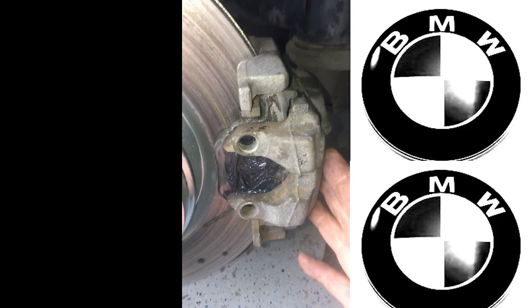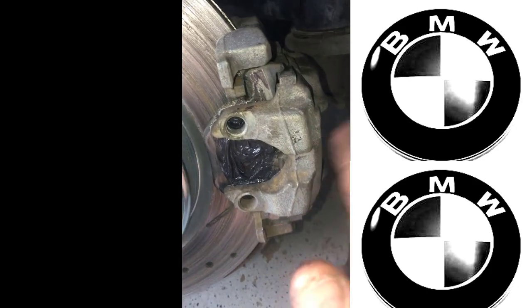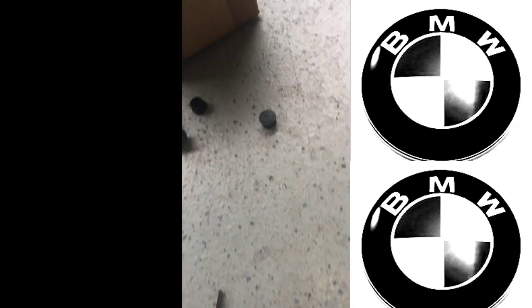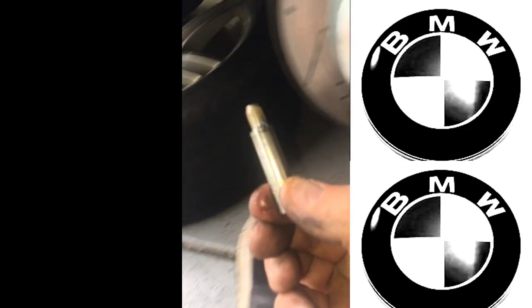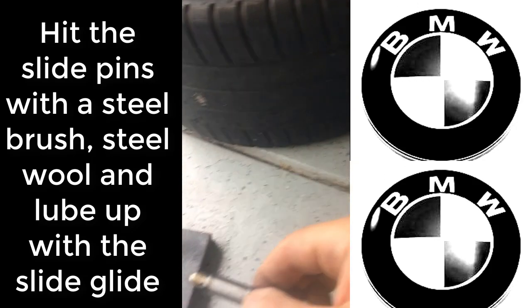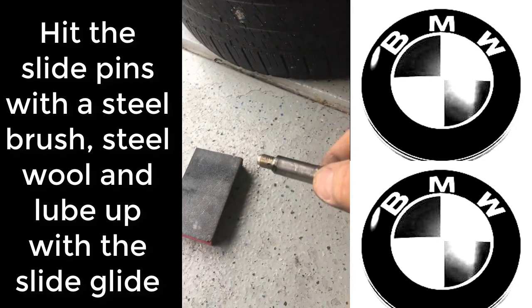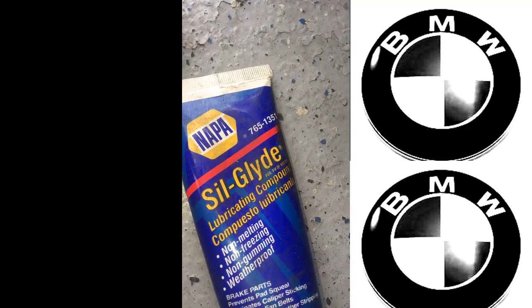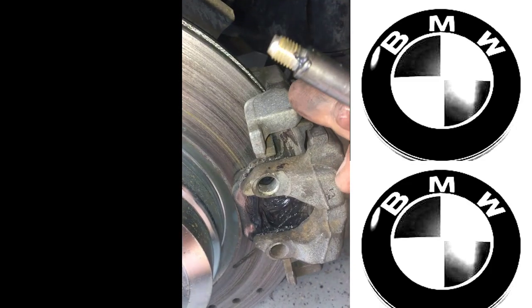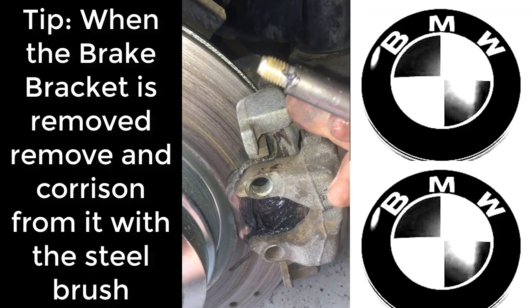That's what it looks like when the rotor is on. The first step to putting the caliper back on is to go ahead and put those slide pins in. As a general rule, I like to rough up the slide pins with a little sandpaper or wire brush, then apply slide grease — that's what gives the caliper free play on the bracket. You also want to scrub out your brake bracket if there's any corrosion on it when you remove it.